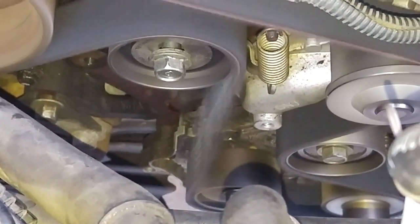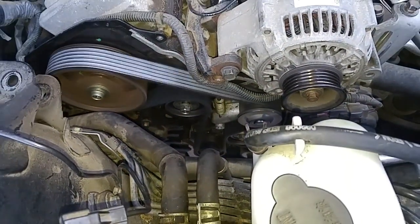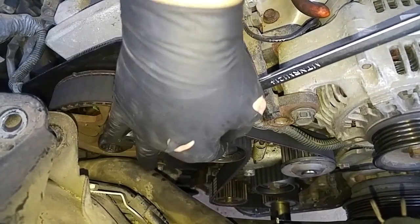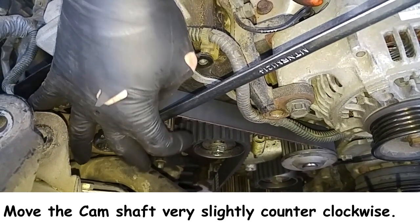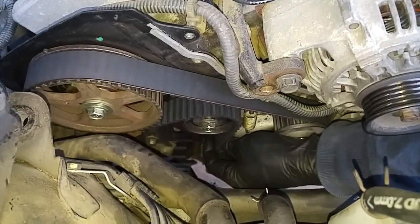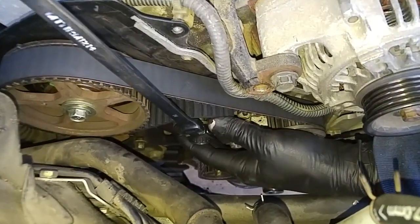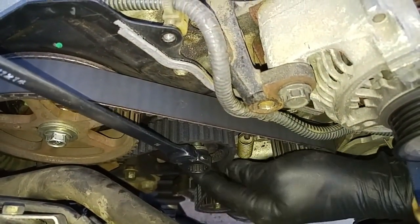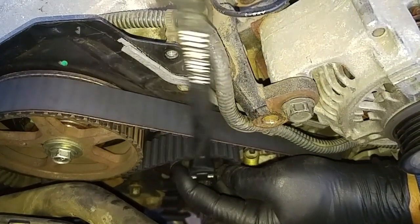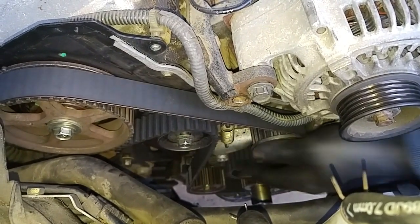There's a lot of wobble in the belt so we're going to shut the engine off. You can see the wobbling right over here — there's too much slack in the belt, so we're going to add more tension. We're going to apply tension on the right side. We've got it good and tight on the right side, but this side is a little loose. So relieve the tension on the tensioner bolt and the spring will pull the pulley up. Now torque it back down — it only has to move a hair, and that's enough to stop the belt bouncing.